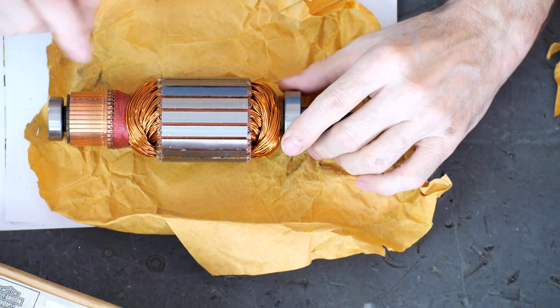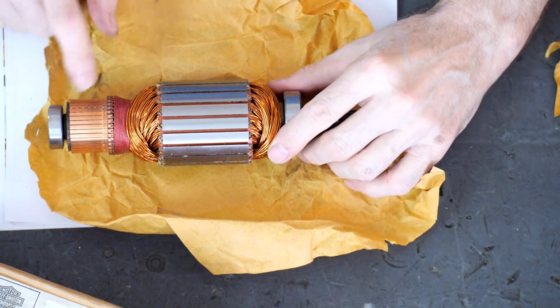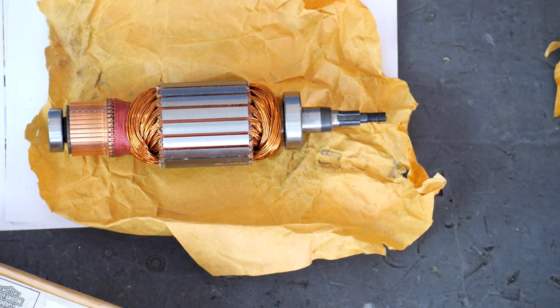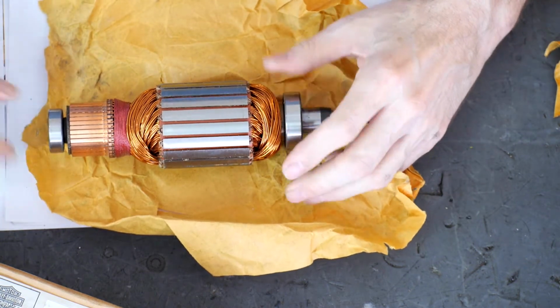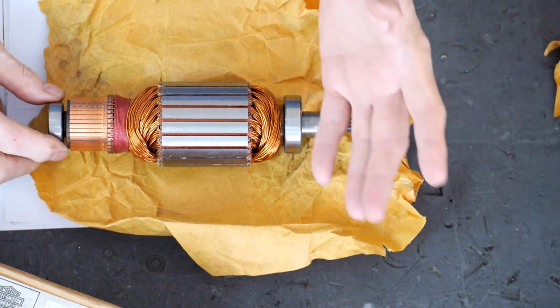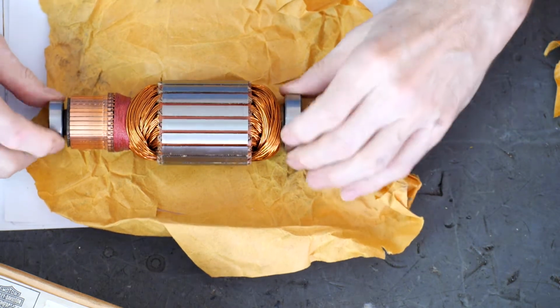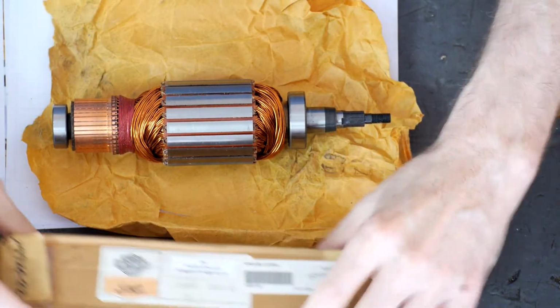It's got this red winding here. The commutator segments are very close together. They're narrower with a very low gap. This is part of what Hitachi brought to the party, compared to this old Prestolite 65A. The bearings come mounted on it. They're sealed, you don't have to worry about lubrication. This doesn't need to get lubricated from the gear case cover like the 65As. These bearings have a little drag, so maybe it wasn't that unusual.